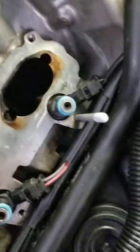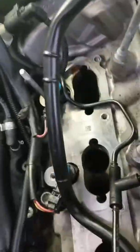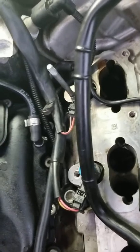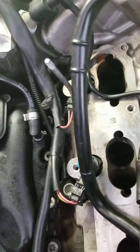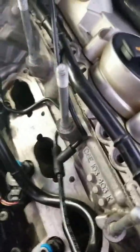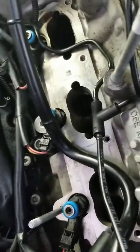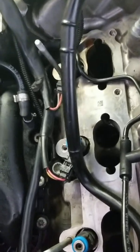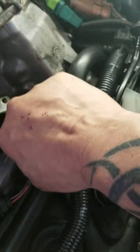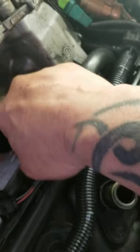So I went to the next one, and yeah, all the fuel injectors were caked with varnish. I soaked a couple of them for a few hours, and then I ran some power through them, and then some pressurized air to blow out, and oh my god, they look nice and shiny and new. I could probably pull one out still. I didn't wedge them in super tight.